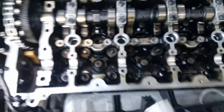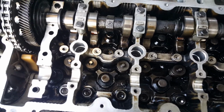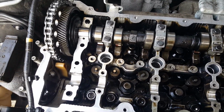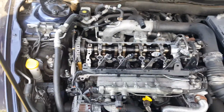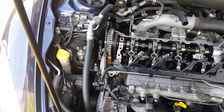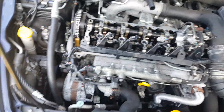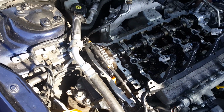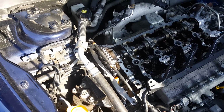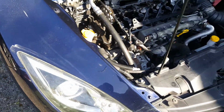But yeah, the blowback issue was I didn't realise they designed an engine with injectors on the inside, which is a real shit idea because you don't know it's blowing. I was accusing the wife of filling the car up with oil, and it wasn't. It was filling up with diesel. It was only when I noticed the oil was beading off of the dipstick I thought, shit, something's wrong here. And then she came back from Newcastle one day and it started clanking around, and I turned it over to drive it into the garage, and it just went bang bang bang bang and snapped all the valves, all the rockers. So bit of a shit.